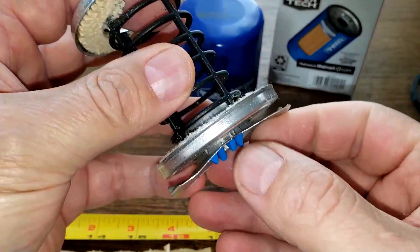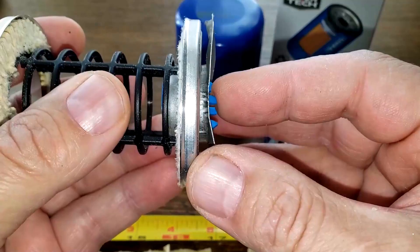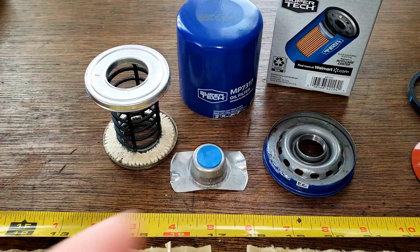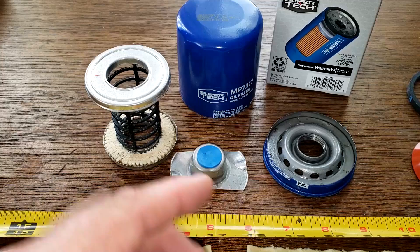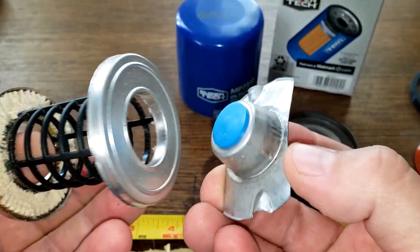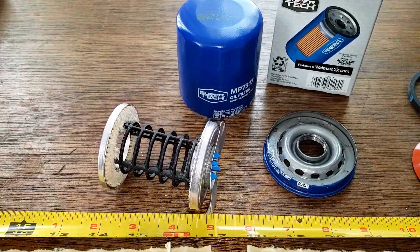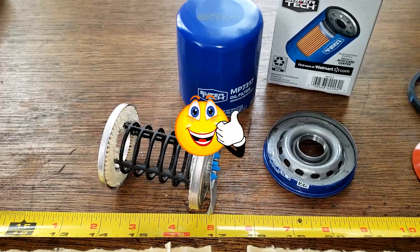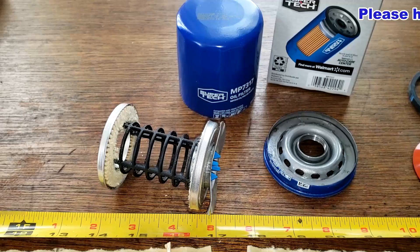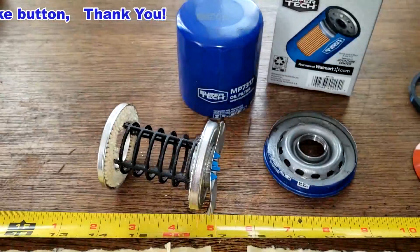The only problem is the end caps. These and the other kind are almost the same thing but a little differently shaped. You can see light coming through and I think they would let some unfiltered oil go through. I never knew that about these bypass valves — did any of you? I think this is a poor design and the manufacturers definitely would know about this — they make them and must do a lot of tests. Post your comments below. Thanks to Dave for bringing this to my attention. Don't forget Oil Filter Fridays — I open up a filter every Friday on this channel. If you like this video, please hit that like button.